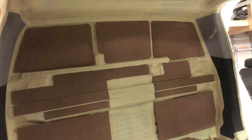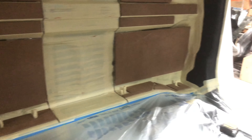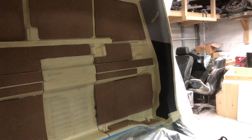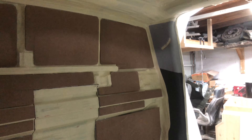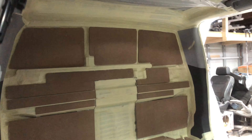All the wood pieces are on here now. I definitely went a little farther than I was expecting, but this should cut down a ton of time when fiberglassing — this is a big piece to glass. Having the wood eat up a lot of those square inches is going to save time and make it a lot easier in the end. Next I need to prep the pillars — I'm going to drill some holes in them, sand them really deep, put some gouges in. When you're doing fiberglass onto factory panels, the stuff does not want to stick. You want to heavily sand it, maybe even with 30-grit on a power grinder, and also drill small holes along the edges so the fiberglass actually seeps in and bonds properly.